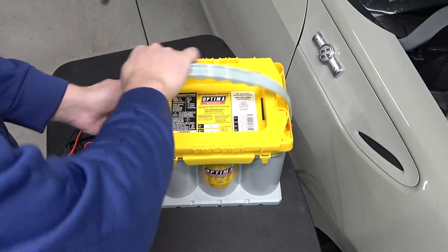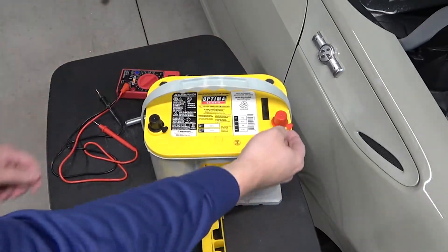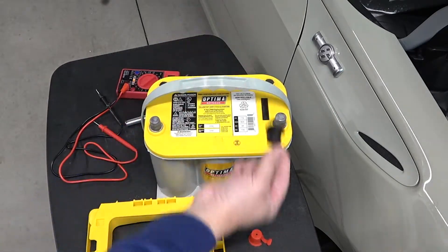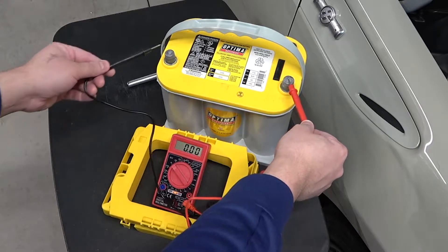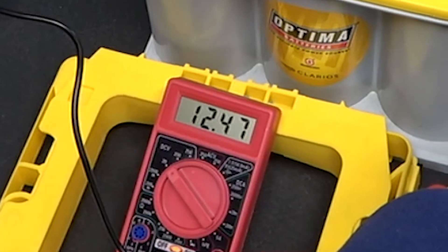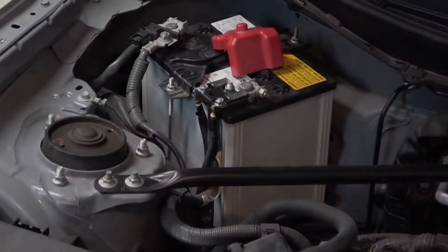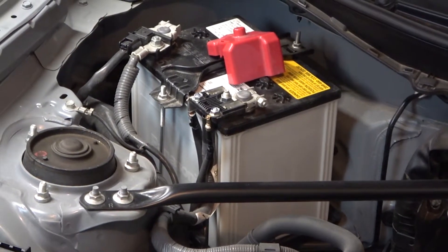While we're at it, let's test the new battery. The normal voltage needed to start a car is around 12.6 to 12.7 volts, so if yours reads any lower, you may need a battery trickle charger to bring it back to health. The magic number for these yellow top batteries is actually 12.4, so anything above that is golden. Batteries can lose charge while sitting on store shelves, so if your new battery reads less than 12.4, you may need to charge it with a proper battery charger.